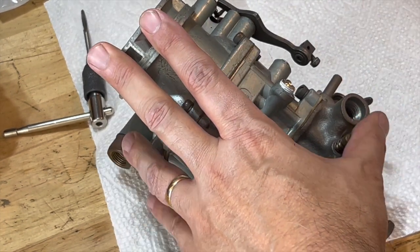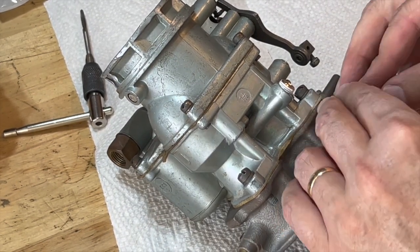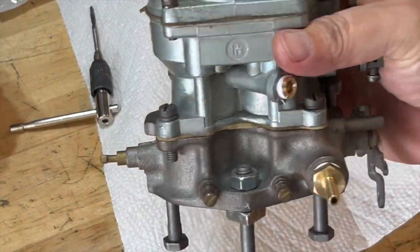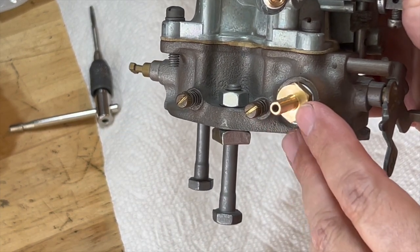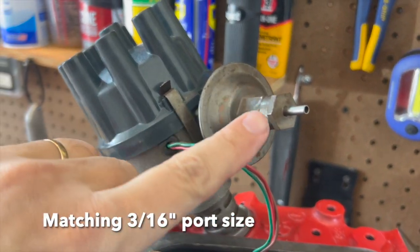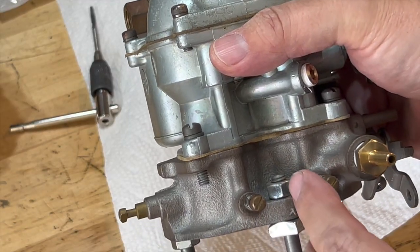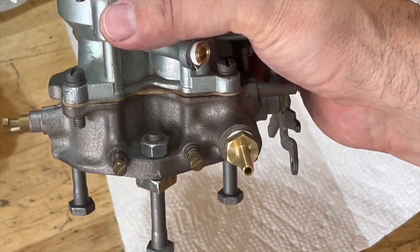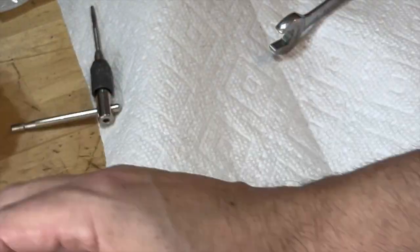Now that we've got our base back on here, we'll go ahead and put these things in. Putting the plug in here to keep you from having any small vacuum leaks. Put our adapter in there — of course, our JB Weld is all cured. And there we go. We're pretty much set and ready to get the vacuum signal that we need to our distributor. Understand, if you don't do this modification and you go ahead and use your Holley 94, you're going to be sending too much vacuum to your vacuum advance on your 57 to 64 distributor, and that could be a big problem.